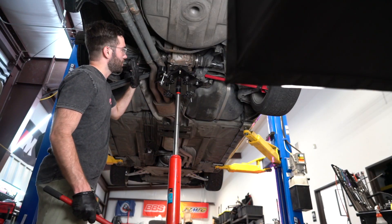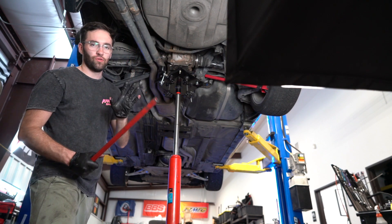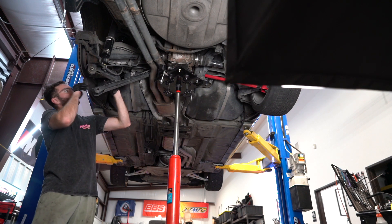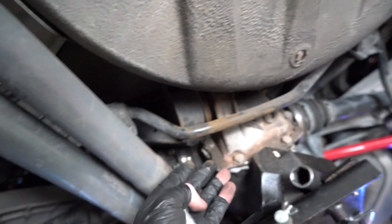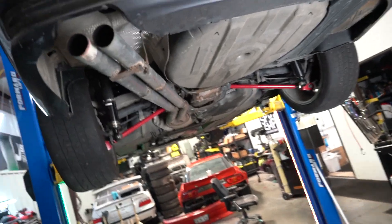To get the bolt out on the driver's side I had to undo the big 21-millimeter diff bolt — the main big one — and barely loosen the back two. I then jacked the diff up just enough to pull the camber arm bolt out since it couldn't clear the diff. That side took me five minutes; this side took half an hour. I got my trans jack out, took the bolt out, loosened the two underneath almost all the way, jacked the diff up as high as possible until it hit the underside of the chassis, and even then barely had room to squeeze it out.